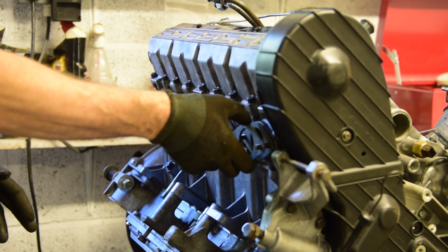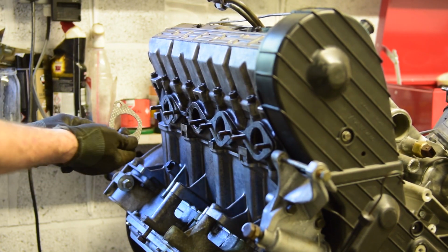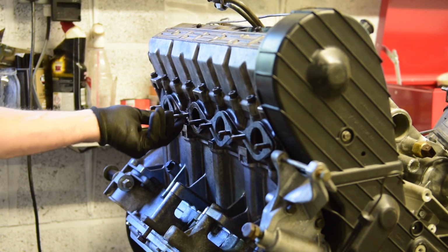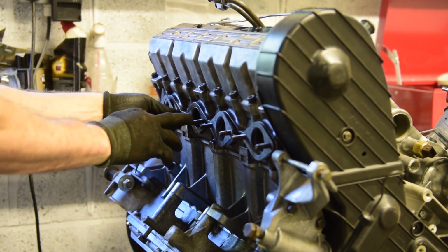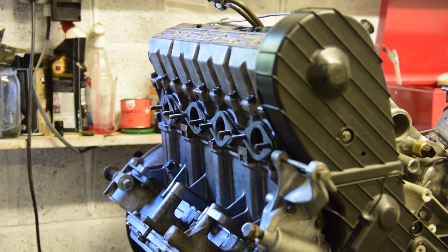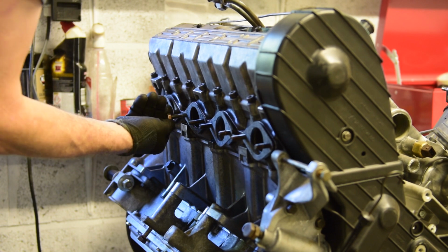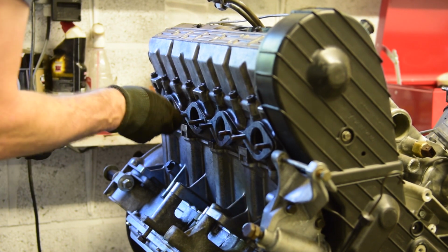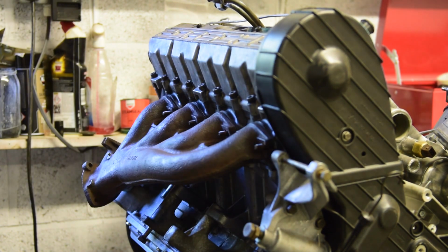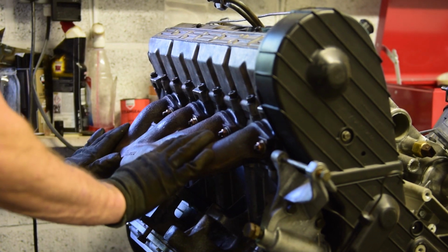Right, now that stud's out, we can get back to business. Where did I put these? So one goes on there. This is the one, that's the new stud. Just bear in mind that's an old stud as well. I've thought about taking that out now while I can, but I think I'll just leave it. If it breaks, it breaks. We'll have it out properly. Now I know I can get studs out, but I don't see any advantage in forcing it out now. I tried before, gently taking it out, but it wasn't really interested. Good. Right, so there's both manifolds on, torqued up.